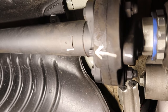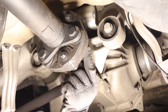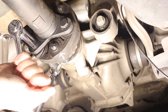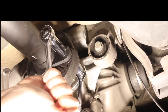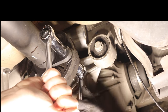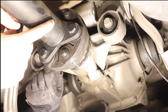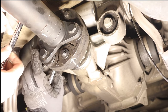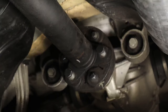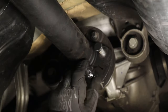The drive shaft and flex disc are held on by three 18mm screws. Remove the nuts — and there's your third one. Once they're loose, remove them from the shaft. Once those three screws are out, grab your E14 bolts and remove them from place. Having something with leverage really helps when removing them, especially if you don't have a lift like I do.